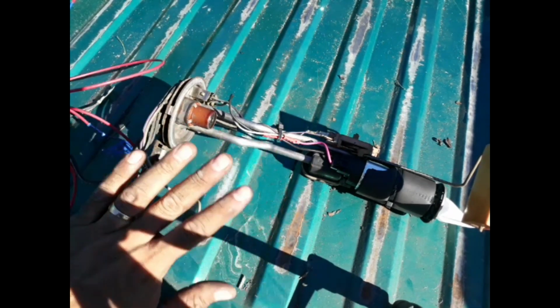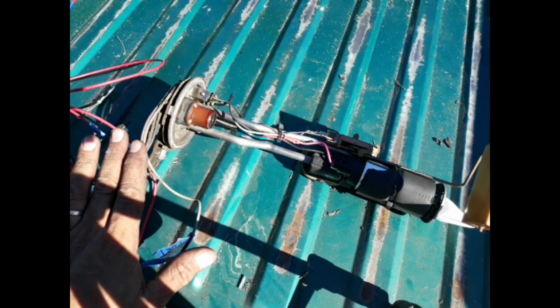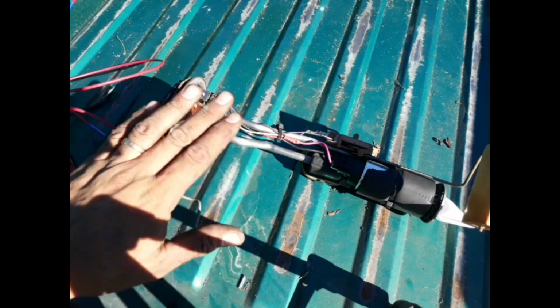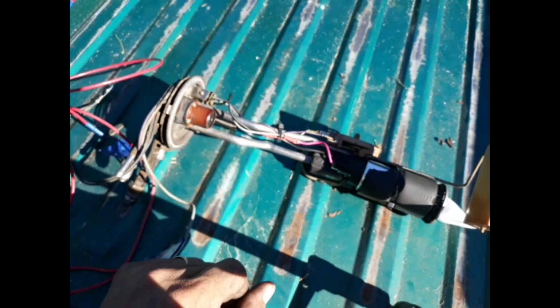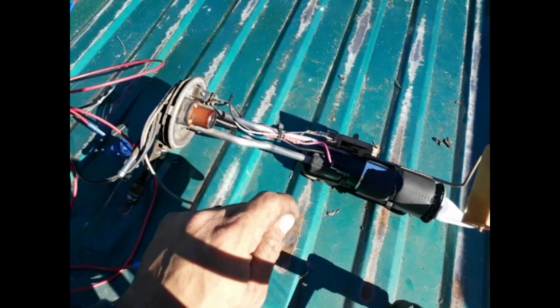I'm just gonna go right back in, snake the wires through the bottom, and I'm gonna route my positive from the fuel pump. I'm gonna leave the sending unit out. I'm not gonna worry about the level. I'll tap onto it later, but we'll see. Send it up to my relay, and then I'll see if I can wire up the relay.